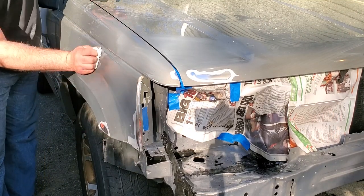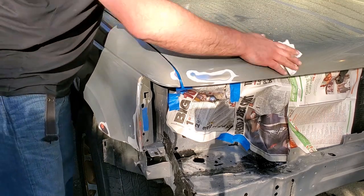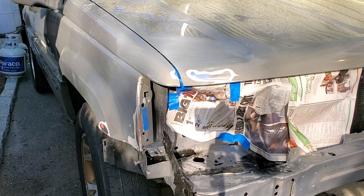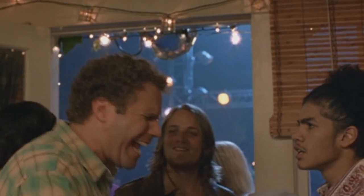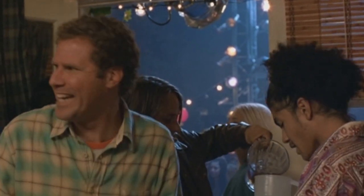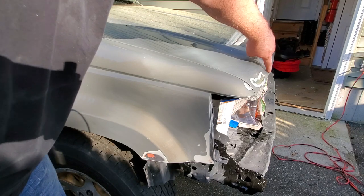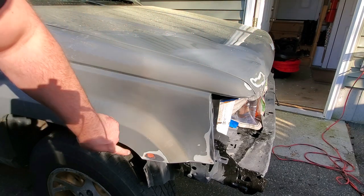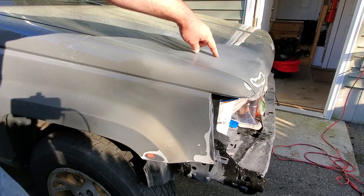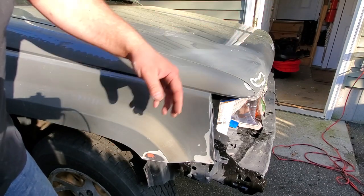What I'm going to do is tape off the front corners, the very tip of the areas that I need to prime. Let me show you where I'm going to make my progressive tape lines. As the water dries from the wet sand you can see exactly where I need to prime — I'm going to tape it off somewhere across here and prime this area. Then I'm going to sand down the primer, apply the base coat somewhere up to here, and after the base coat if all goes well I'm going to put the clear right up to about here.